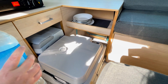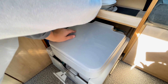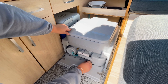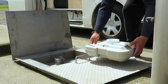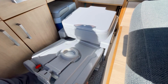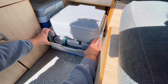To use the toilet, press it once and it will slide forward. To activate the flush, water needs to be filled on the right side. During use, always pull the lower lever forward to open the waste hole. The left button operates the flush. To empty the toilet, fold the lower cover forward, remove the flush hose, and pull out the cassette. The cassette can be emptied at any dump station. Afterward, reinsert the cassette and reconnect the hose. Use the provided toilet chemicals to control odors — just flush once and the toilet is ready for use again.